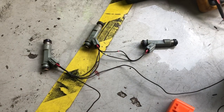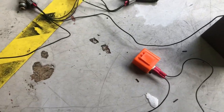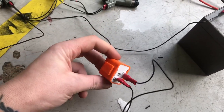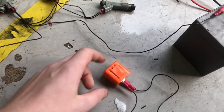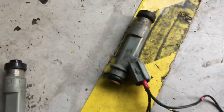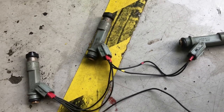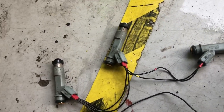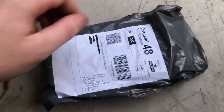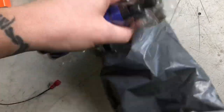We want them to open and shut while they're in the cleaner. What I've rigged up is a nice simple circuit — that's a flasher unit for indicators on a bike. When I connect this up, as you can hear, that's going to be opening and closing the injector whilst it's automatically cleaning. I'll show you something else as well. I got sent this by a fan of the channel.